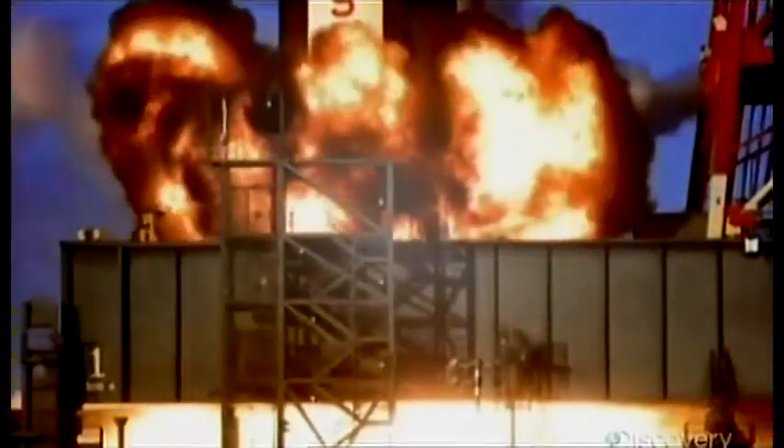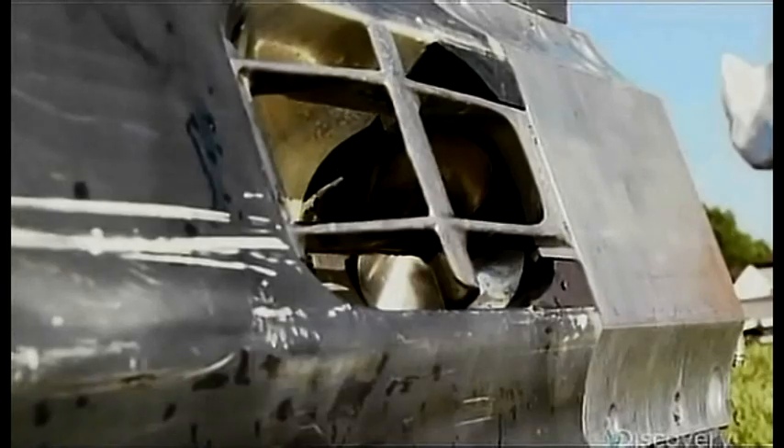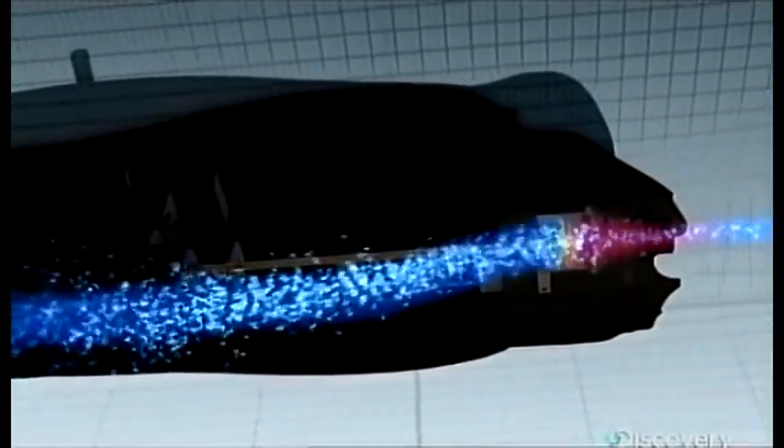To see what powers a jet ski, take a look at this rocket demonstrating that every action has an equal and opposite reaction. All jet skis are water rockets — push a stream of water one way and the machine goes the other. Its powerful water jet is driven by an impeller, which is pretty much a propeller jammed into a tube. Impellers take water in through a wide opening and force it out through a smaller one, creating what's called a venturi effect, where low-pressure water behind the impeller pulls more water towards the blades, increasing its speed.